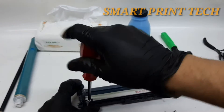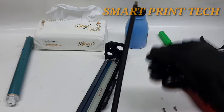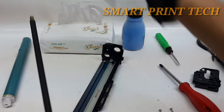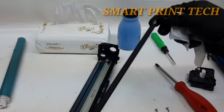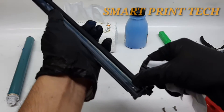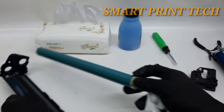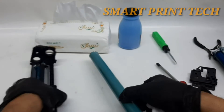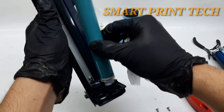After one or two refills, we recommend that you empty the waste toner container, because otherwise perfect printing quality cannot be guaranteed. Please note that refill toner and toner powder may cause serious health problems if not handled carefully, so we recommend always using breathing protection while refilling a toner cartridge. Furthermore, toner powder can be highly flammable with an appropriate oxygen mixture. You should not touch the photo conductor drum in any case, or expose it to direct sunlight, as this could lead to faulty printouts.